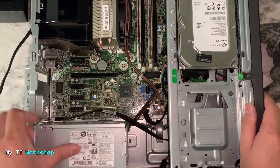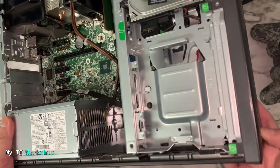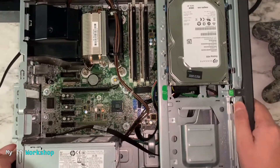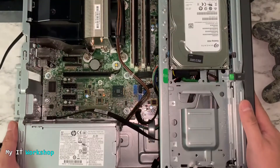I know this because this computer was working a few days ago. As you can see, it's connected to power and I'm trying to turn it on — nothing happens. I'm showing you my bubble wrap and no air is coming out of the fan from the power supply, so I think it is the power supply.